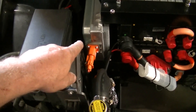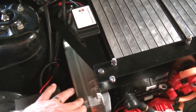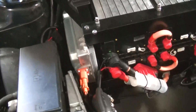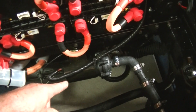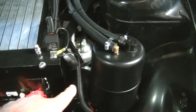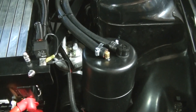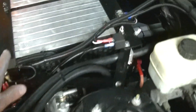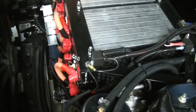So here's what we got. All the batteries hooked up. We got the 500 amp fuse here. This is the DC to DC converter out of a Chevy Volt. This is an EVCC basic CAN controller which controls the DC to DC converter — works great, thank you Thunderstruck EVs. We have the water pump down here for cooling the motor. Here's our vacuum pump and vacuum canister — I put an extra canister on here just to have plenty of what I need. I made it simple and put both relays, one for the water pump and one for the vacuum pump, right here nice and close, easily accessible.